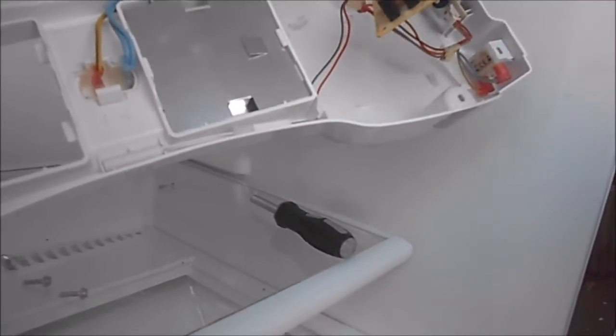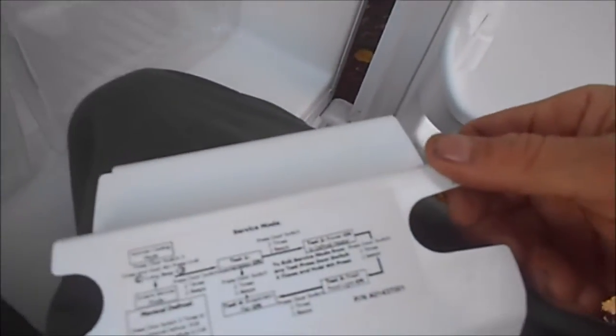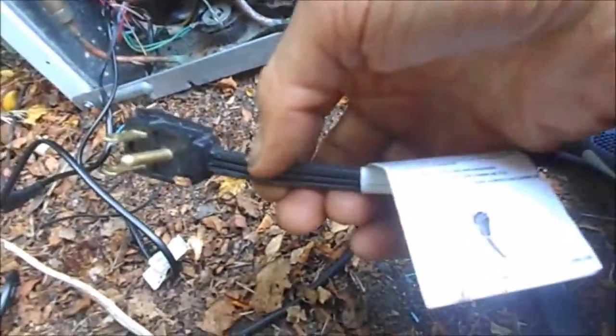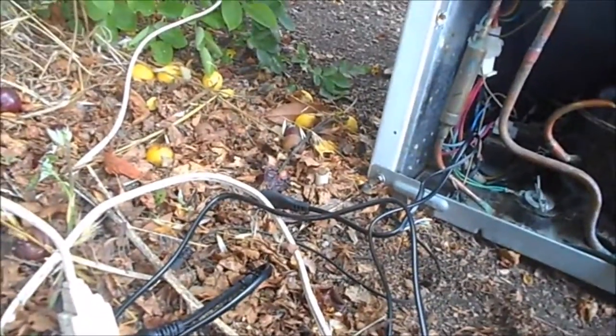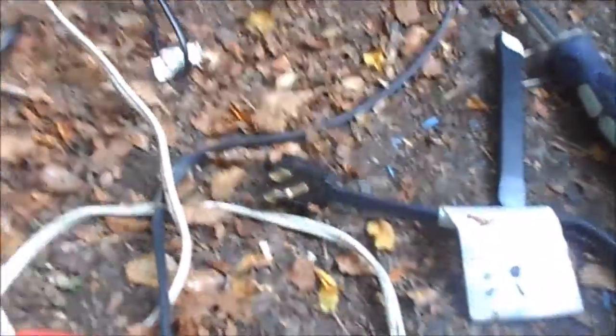The other thing I could do is check the voltage going into it — likely the black and blue wire. What I did is I put a new plug on it. I wired the wires, bypassed the original plug, and wired up to where I found there was no juice. We can double check this to see if we have juice at this plug as well, but it's kind of hard to do with one hand.